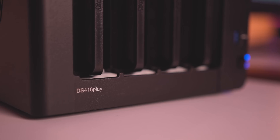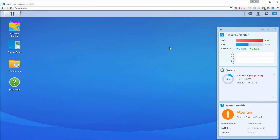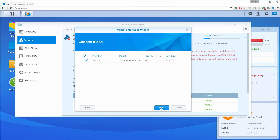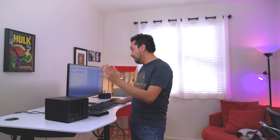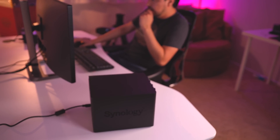Once you replace the hard drive, just put it back in — it's really simple. You need to repair the RAID array, and to do that, go into the main menu, then storage manager, then volume. Click on manage, and there will be an option that says repair — just click next. It'll confirm it's disc number three, click next again, and it'll tell you that all data on that drive will be erased. Hit apply, and in a matter of seconds the beeping will stop and all your data will once again be spread across all of the drive bays.